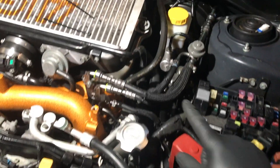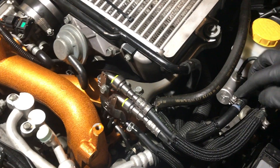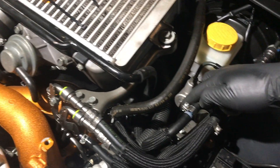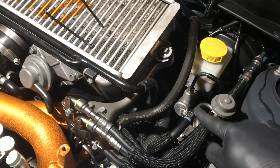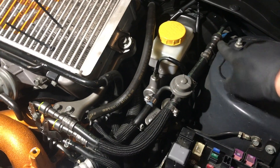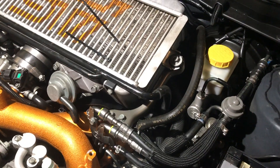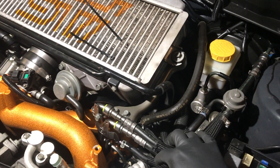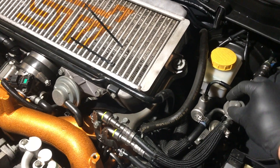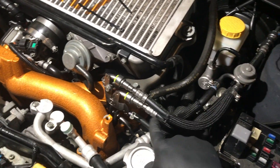So we'll do that and then we'll start taking off these hoses. Here's the culprit — this little tube that goes from here to here is what I've read is what the problem actually is. There are two lines that run from right back here to right here, right on top of each other, and they need to be replaced to fix that GR stumble. This is your fuel pressure regulator, this is your fuel in, and then the bottom one is your fuel return.